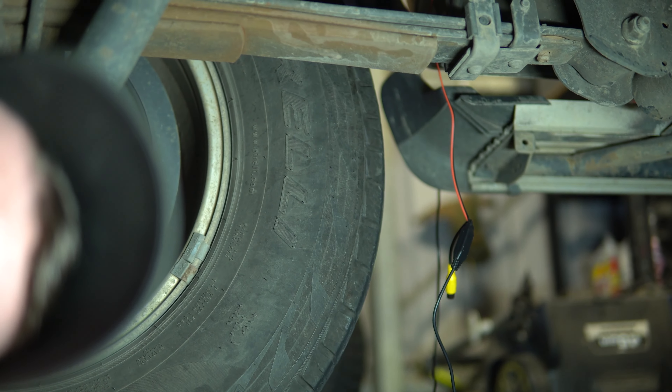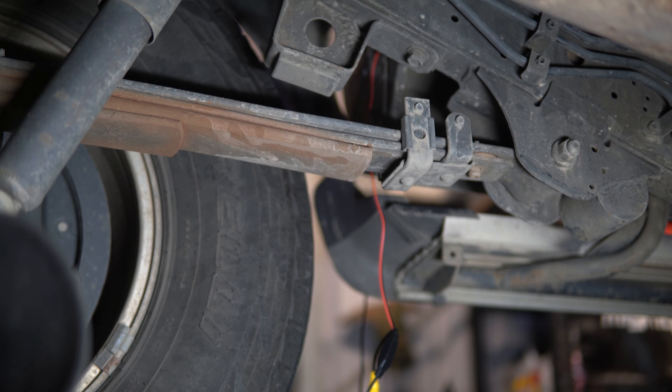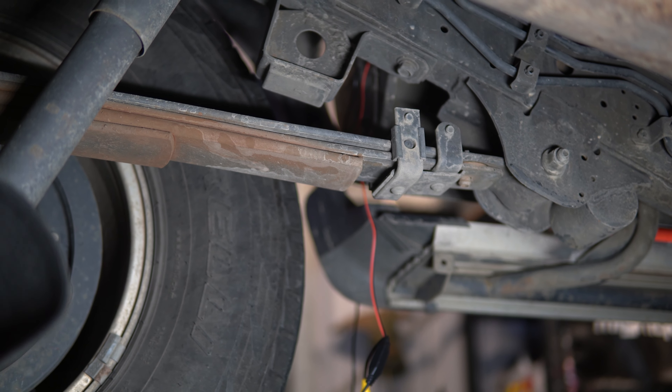I've traced the wires all the way back to just behind the rear seat. I looked around to find a factory grommet or existing path to get the wires through to underneath the tray, but I can't find one anywhere. Unfortunately it looks like we have to drill through the back wall. I'll just do a small hole just behind the seat for the wires to pass through and go underneath the cab. Once I've drilled the hole and traced the wires through, I've put a little hose over the wires to protect them, and I'll seal around it with silicone so no water gets in.